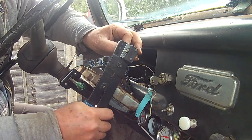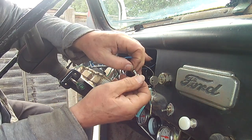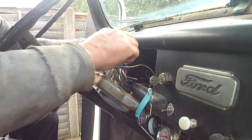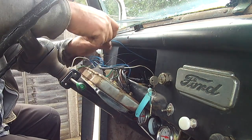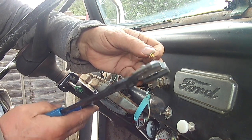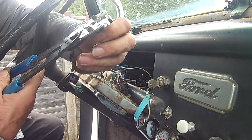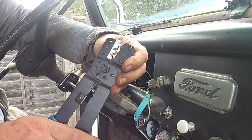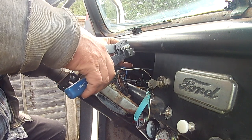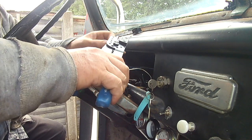Just look to see it pop out the other end and give it a good squeeze — a really good squeeze. That's a good crimp. I'll put a bit of heat shrink over that, but I won't bother with that one because that's earth. This one needs power — that's the power for the instruments there. To be honest I could do with a slightly smaller connector — these are very thin wires, but it's a very lightly loaded circuit. I'll use the bigger crimp on this one, then swap it over to the smaller one once it's started.